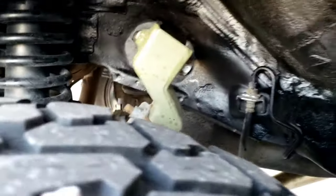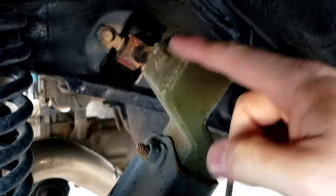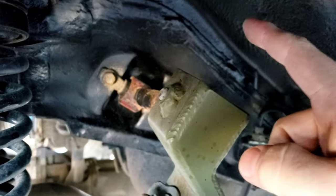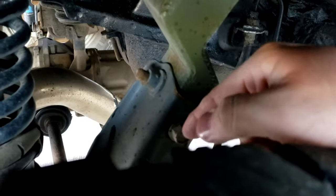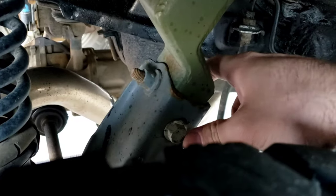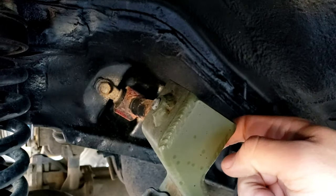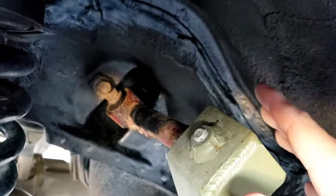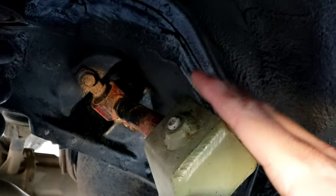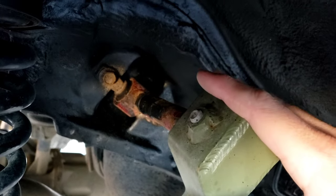It was nice. So up here, you're going to go with your camber arm extender, and it's going to bolt to the frame here. You got to drill through here and get this bolt and nut. And then you have the stock mounting point, and you have another bolt. Adjustable camber arm, highly suggest. Again, I got black on stuff, I just sprayed everything, so just deal with it, it comes off. I was being lazy, so that's my own fault.